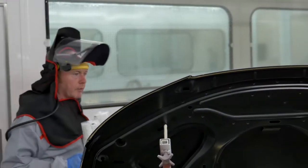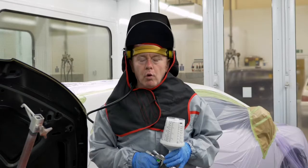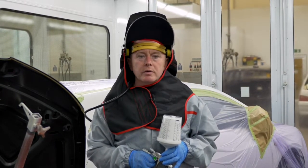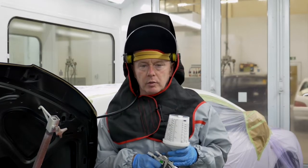I've mixed my wet on wet, the colour, and the blender I need for the quarter panel — now I have everything I need to do the job in the cabin. All products are mixed as described in the TDS; please ensure the base coat is activated or hardened. Before I start application of the wet on wet I had a few minor sand throughs to bare metal that I need to deal with.